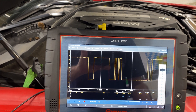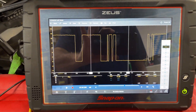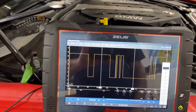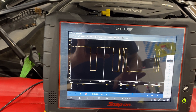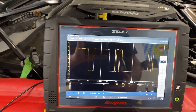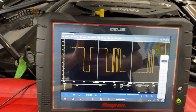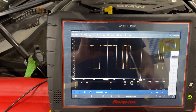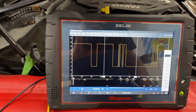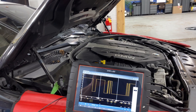From 0.2 volts to 11 and a half. Hopefully you guys can see it despite the glare. I'm just trying to help somebody out there looking for information on how the signal should look. When you have a line disconnection, most likely you're going to have a problem with a wire. Obviously check powers and grounds and make sure that the module — it looks like just a pressure sensor with a switch going over to the canister valve. Very simple, but this is something not even the dealer could fix, and I wanted to share this with you guys.